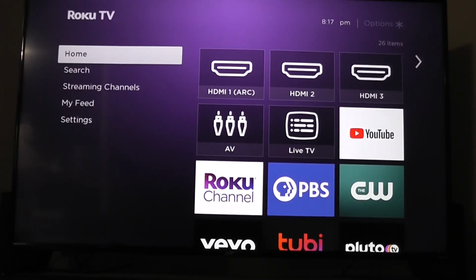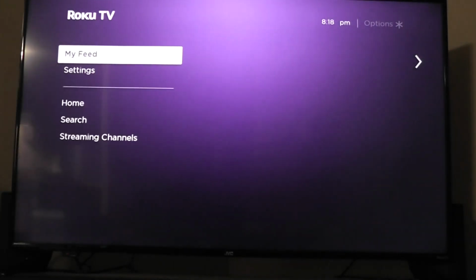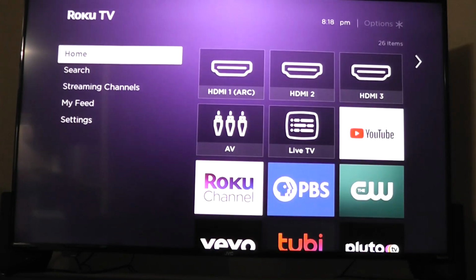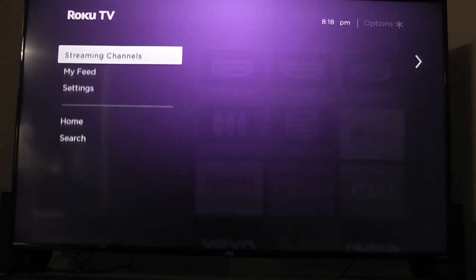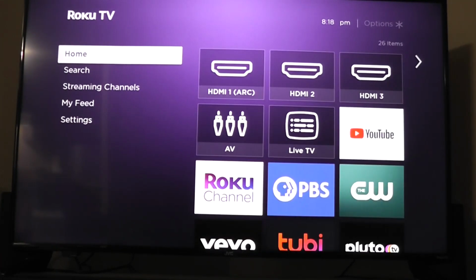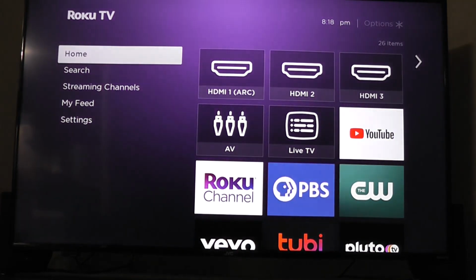So here's the real demonstration: the infrared remote is just so cheesy, and there's some kind of processing delay. Clicking as fast as I can, you can see how the menu jumps around, but when I use the voice remote, which is radio, it registers each click. Each of them registers. It's just much quicker.